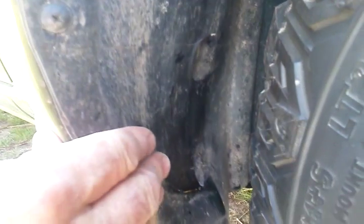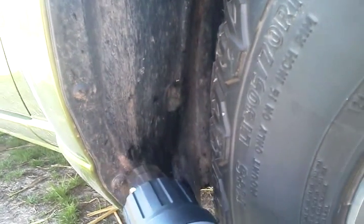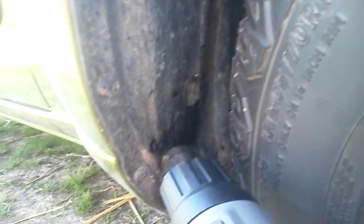Got it just a little bit hot there now. We're trying to see. Well, you can see when it cools back down, it stays whatever shape that you want. But you have to be really, really careful not to get it too hot, because your hammer or whatever you're pushing will actually go all the way through it and make a tear, because it just turns into liquid. And be sure you don't get against the paint in here. Right. The paint will just completely come off.